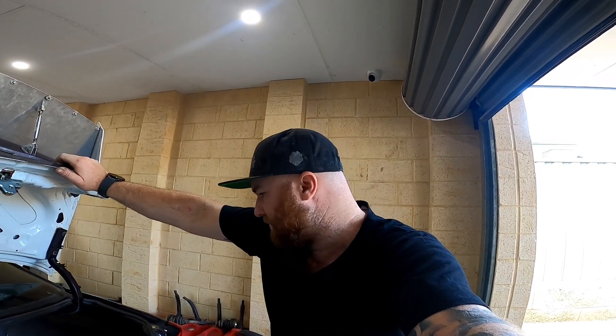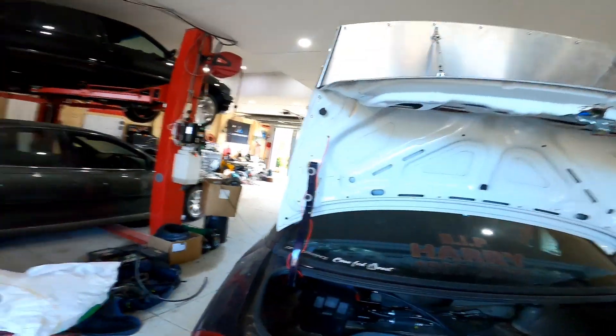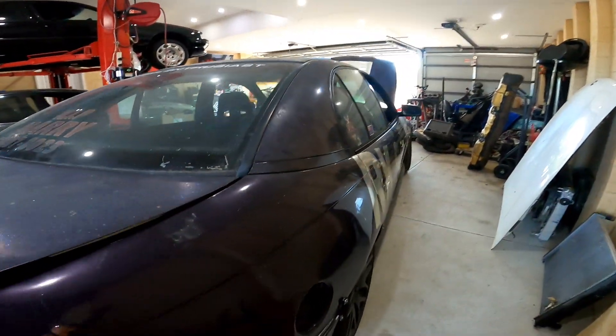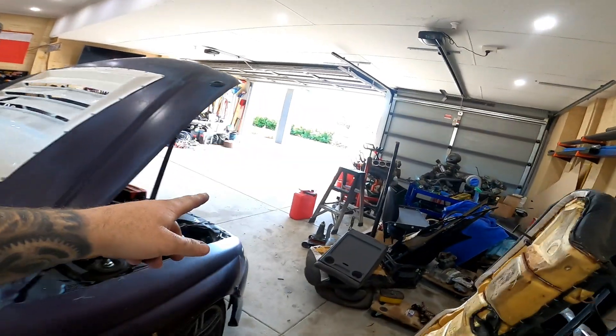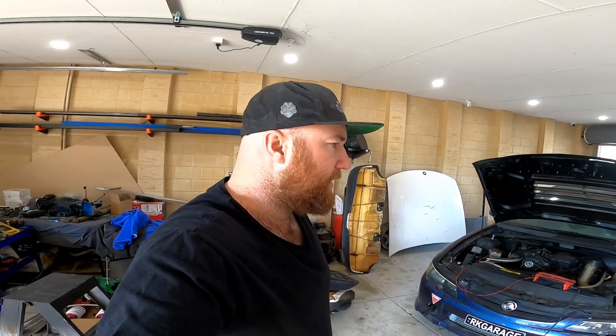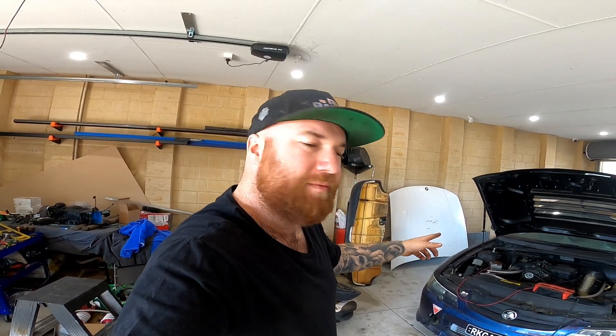This made 597 with ease on Ecojet's motor back in the day, so I've got no issues for what this drift car is going to make. Obviously the battery's in the rear — it's had a big hit and everything's kinked over to the side. I drained out the 98 earlier and put it into the L67 project car. I've got the fuel here, just one jerry can, so let's get that in. Then we'll jump inside the car with the laptop and fiddle with the tune to get it to work — see what we need to do going from 98 to E85.